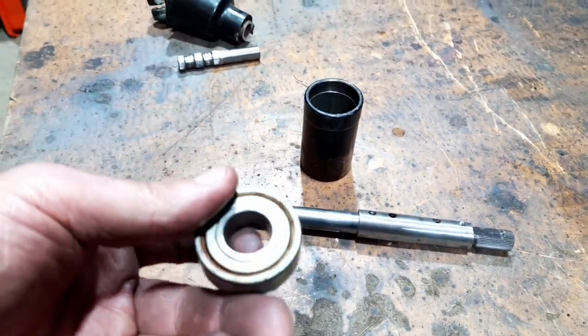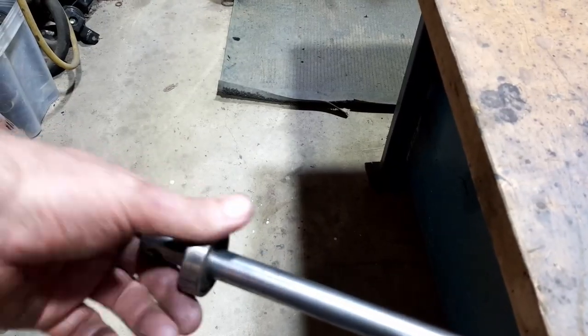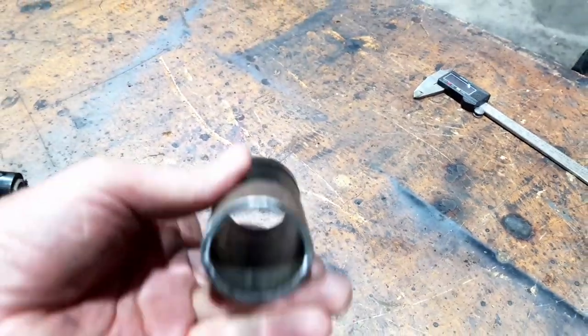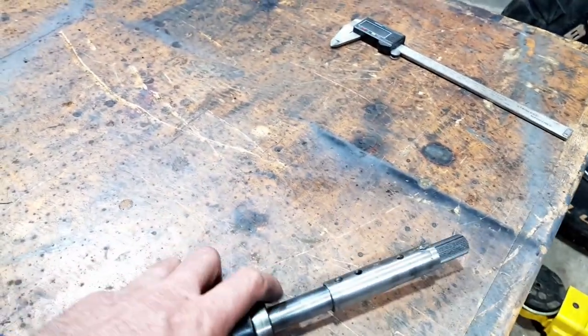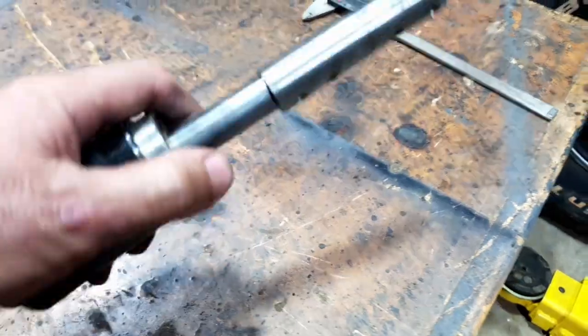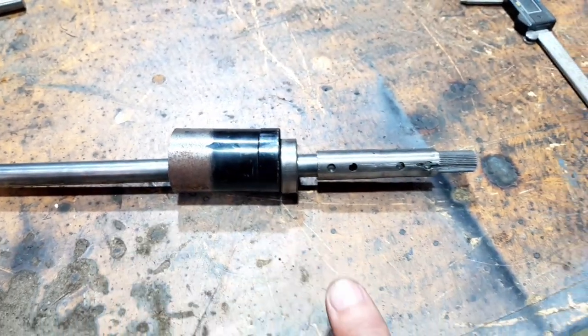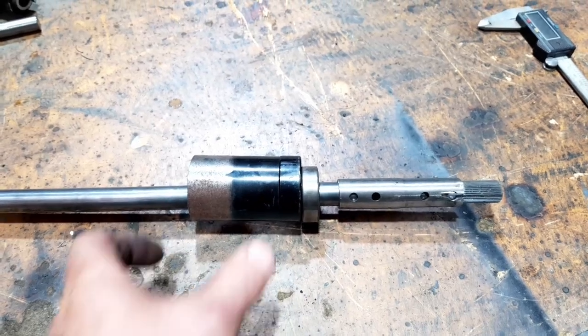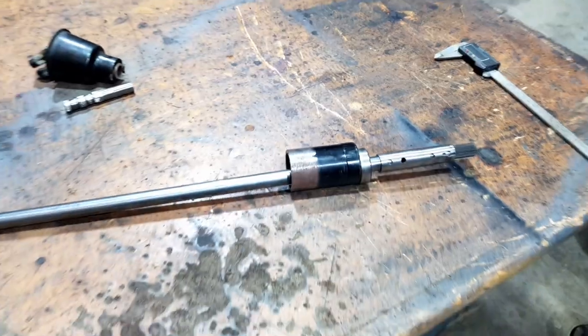And the bonus is this bearing, which I'll use because it was on, get it on there, there we go. This bearing fits all the way down there. And here's the part of the treadmill tube that the bearing used to sit inside. I will then just push that in there. So then I'll just weld the bracket on from here down to the firewall, or to the chassis. I'll bolt that all down to the chassis, and then we'll have all our stuff done.